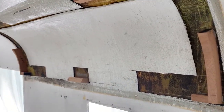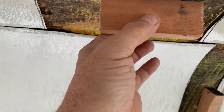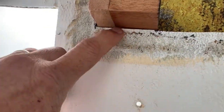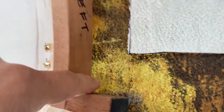The kitchen cabinet is going to have all these blocks fiberglassed in place, and then the cabinet will be attached with little rubber washers and nuts and bolts. I can see right now the elephant skin. I have about three-quarters of an inch here — that's not much — but over here I have about an inch and a half of extra, so I'm going to cut about half of this out. I want to fiberglass this mahogany to the shell itself down below as well, so it'll be fiberglassed all the way around.